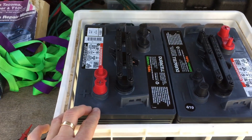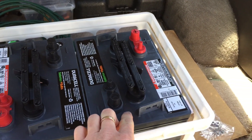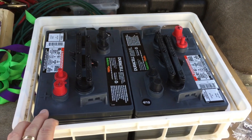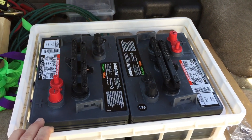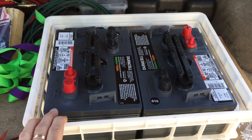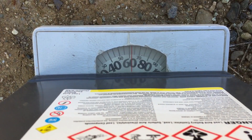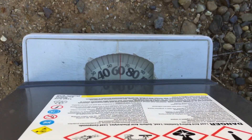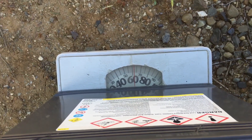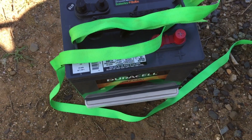This one meters out at 6.26 volts, this one meters out at 6.30 volts — that's pretty good matching. I'm going to go ahead and get these installed so they can start charging. I've got the solar on the camper so it should charge up just fine with the MPPT controller. These new batteries weigh in at about 62 pounds and the old Exide batteries were 61 pounds. I had three of those and I'm going down to two of these 6 volt batteries, so I'm saving about 60 pounds.